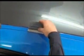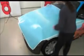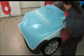After the vinyl has cooled down, the holes for the smaller car parts can be cut out carefully, and the vinyl applied to the hollows with the help of hot air. The hot air-assisted application of all other cut edges also has to be performed with great care. The vinyl is then positioned centrically on the hood and cut free with some margin being left.